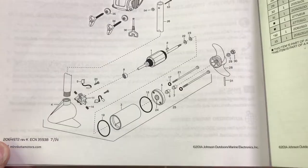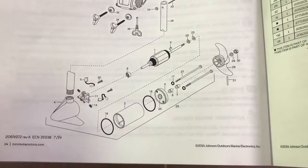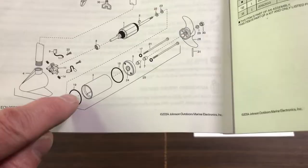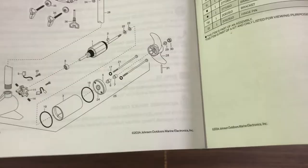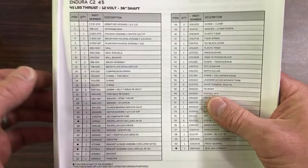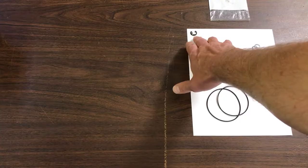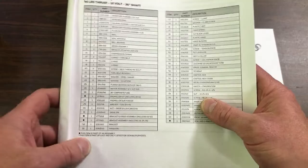Here's the parts diagram of the parts I'll be replacing today. I'll be replacing these brushes — one brush was bad, the other was still okay, but you replace them as a set. Then the springs, a bearing, an e-clip, some washers, o-rings, two seals, and o-rings for the bolts. When I ordered the kit, the part numbers matched up except it had an extra ball bearing and extra e-clip, but these kits are made for multiple units.